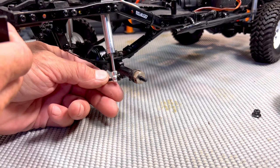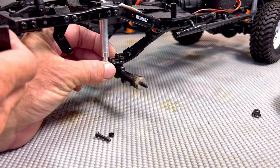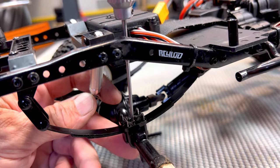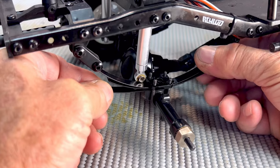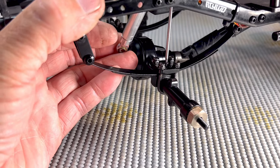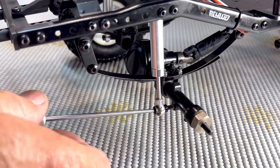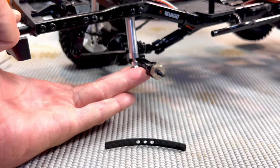So for this portion of the video, we're just going to remove the helper spring. On the TF3, I just remove the lower screw from the rear shock and push it over to the side. Then I remove the four nuts from the top of the U-bolt plate. Next, remove the screw in the U-bolt plate that holds the leaf springs in position. Now you can slide the helper spring out of the pack, reinstall the center screw on the U-bolt plate, and evenly tighten down the four nuts. Reinstall the lower shock screw, and you're good to go.